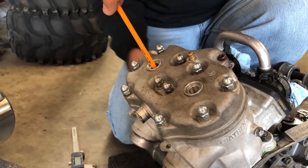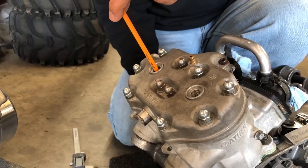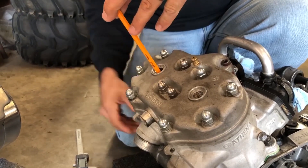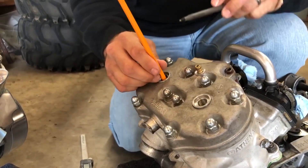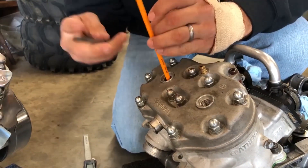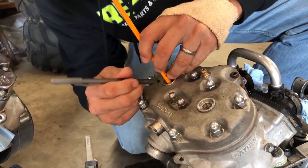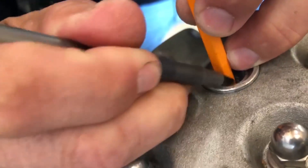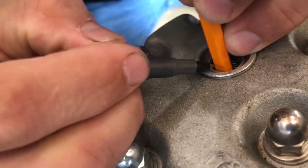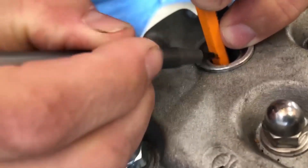I'll show you so you can see the numbers moving up and down. That's low — and there's top dead center right there. Now I'm going to take my pen and make a mark on this pencil. This is top dead center — I'm just going to make a mark right here on the pencil. This is a little crude, but it works. That looks like about top dead center.